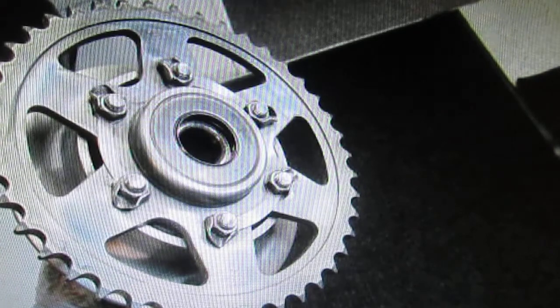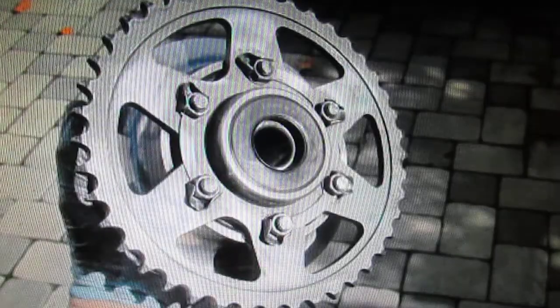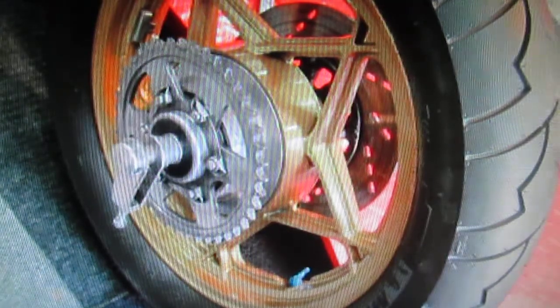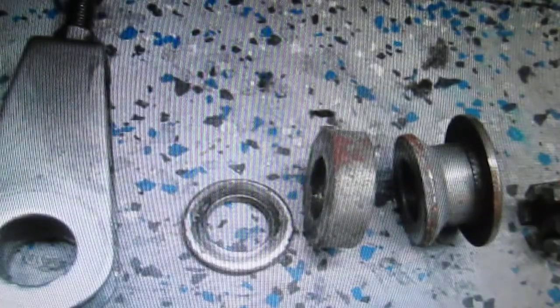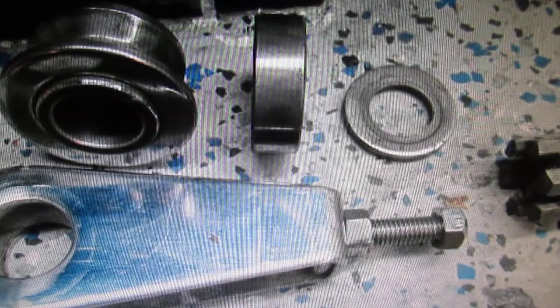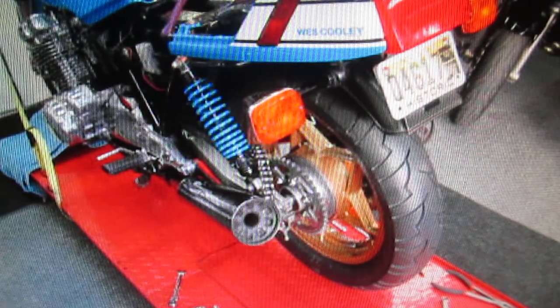Once that's done, I wanted to clean off the grease with a wire brush and clean everything up as much as I could using kerosene parts cleaner. All the spacers need to be wire-brushed, then run on a buffing wheel on the drill press. No dealer is going to do this - unless you probably pay $300 to change your tire. Even this little bit of rust is all cosmetic - these parts will be fine - but how much nicer to work on a bike where five minutes later the parts look brand new. How nice it is when you have the whole sprocket assembly put back together and everything is clean.